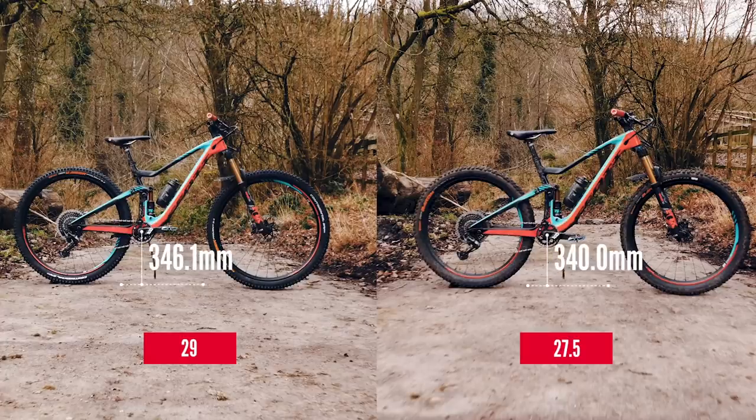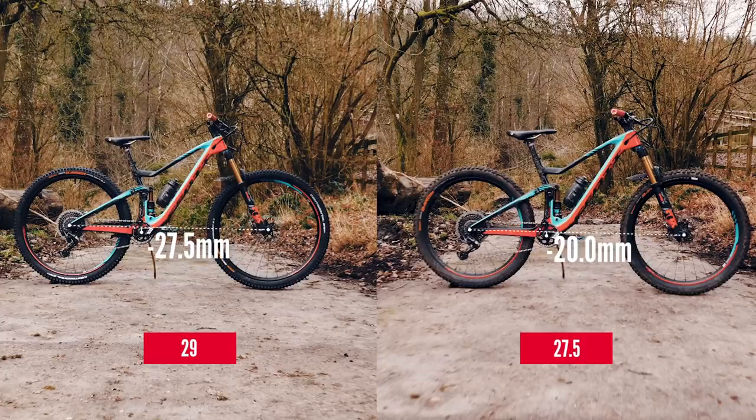There's something often not taken into consideration with big wheels: they actually don't slow down as fast. The reason for that — a little bit of theory — is bottom bracket height. On 27.5-inch wheels, your bottom bracket is roughly in line with your wheel axle. When you go hard on the front brake, because you're quite high up on the bike, you load the front wheel, so you get a lot of traction and can slow down faster. With 29-inch wheels, your BB in relation to the wheel axles is a lot lower. When you apply the same braking forces, you actually push forwards a little bit more than you push down, meaning combined with the extra speed and the fact that the wheels are bigger and heavier, you don't slow down as fast.